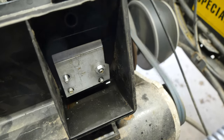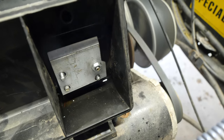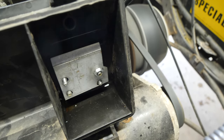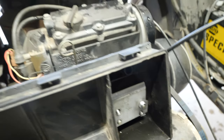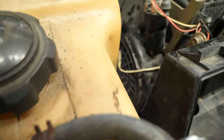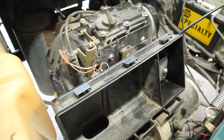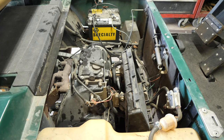Let's turn the key on. That's half throttle. It looks like we are dripping fuel. I think we need to get this whole assembly off here and then we'll work on the valves. The customer did say he smelled gas and thought there was a fuel line leak somewhere. Let's get this apart.